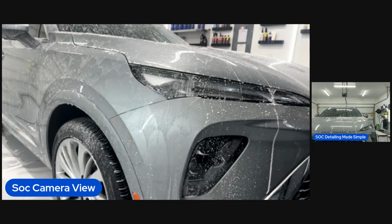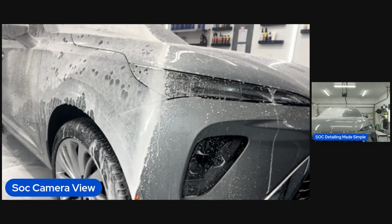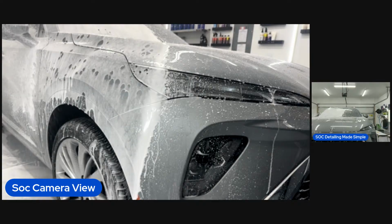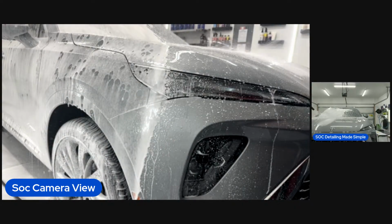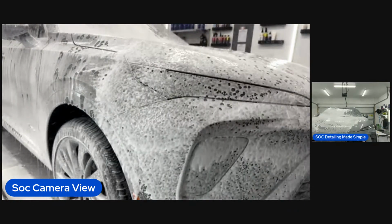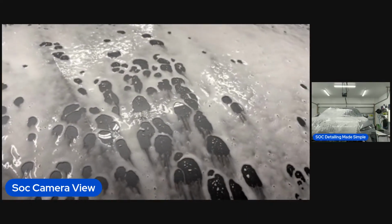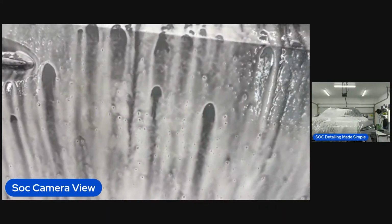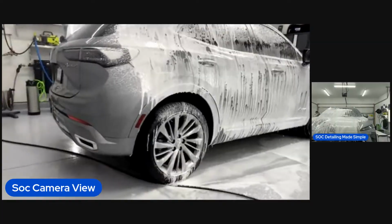So let's see what happens. It's either that or the coating. I don't know. Or maybe the water. But 500 mils of water and pretty much 4 ounces of Wakeeater. Back around here. It foams up decently well now, of course, for 4 ounces, but with the C6 coating, it is just rejecting the soap pretty much ASAP. As you see here, it's grabbing on. It's the running one. I may need to change the actual orifice of this foam cannon to get more foam.